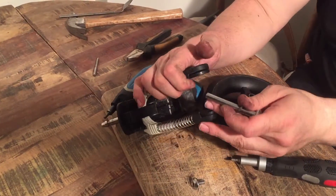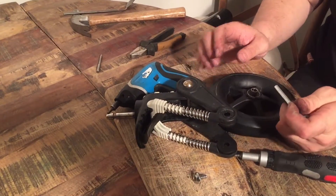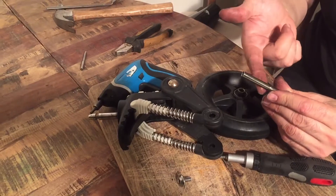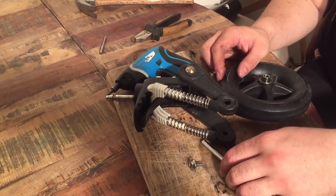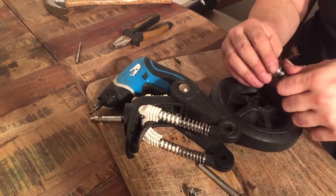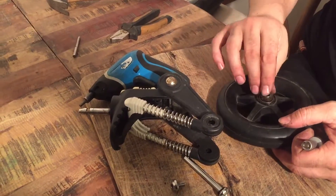To get the axle out past these parts, you'll eventually be able to remove the suspension system. If you have the second problem where the ball bearings have broken, you can cut the inner part of the ball bearing off the axle to preserve the axle, but perhaps we'll show that in a future video. In any case, that's how you remove the axle, and then you can remove the ball bearings just with a screwdriver in case you need to replace them — it would be the same on the other side.